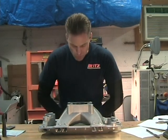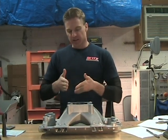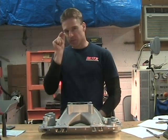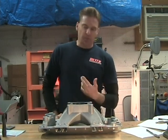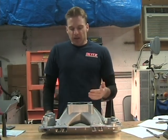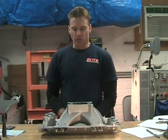This was the next area I worked, and I tried a couple of different techniques. Some I moved back a little bit, cut them down and inched them back. Some I left in the stock position and slimmed them down. Some I really knife-edged down to a razor edge, and another I left at about 40 thousandths — a little bit thicker — but just blended it in.